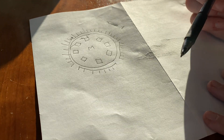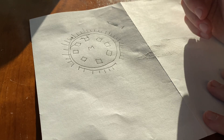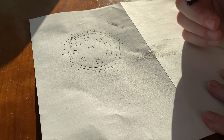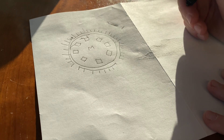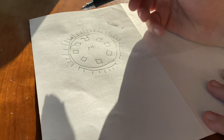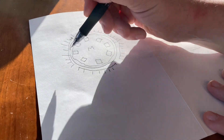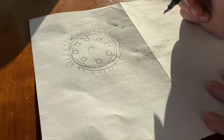This is really clever. If you're familiar with ferrofluid — we played around with this in physics — it's a magnetic, iron-based fluid that reacts with magnets. You'll find tons of cool videos of it on YouTube. As you run your motor, the centrifugal force shoots the ferrofluid to the outer wall, filling that entire gap, and it then conducts that heat outwards to your heat sink.